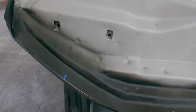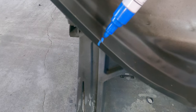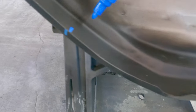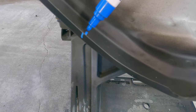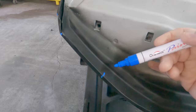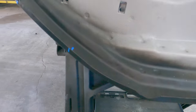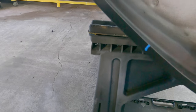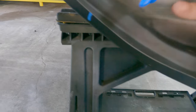I went ahead and put some blue marks. I don't have the welding device they used at the factory — effectively they used two electrodes, came in on the metal at a point here and a point down there, put the pieces together, folded it, and spot welded them together. Not a pinch welder, but a regular two-point contact welder, and they used many more points of contact. We're MIG welding because I don't have that device — it's a little pricey and I'm not going to afford that out especially with buying a new house recently. So I've marked where I'm going to punch: just three points on one side, three on the other should be sufficient.